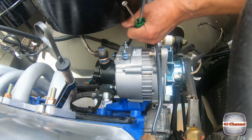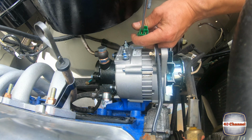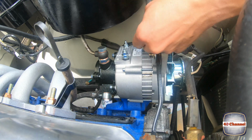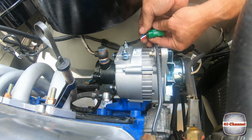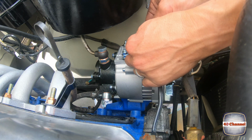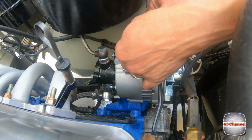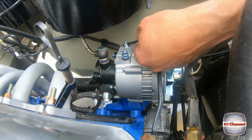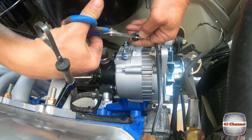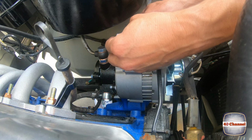Righto. So we've released all those pins, pushed them out from the existing plug. Just like that. So we may need to just push up our little locking tab. So we've pushed them down. Cut this rubber tab off just to make our life a whole lot easier. Glue up the top.